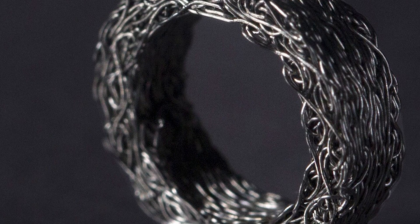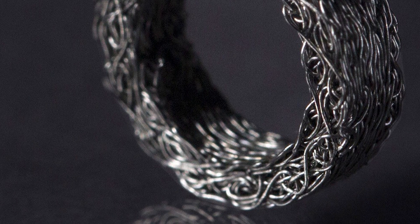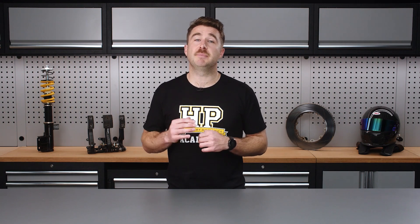In some cases, metal matrix type bump stops are used. Here the bump stop is made of a matrix of very small diameter wire. One of the main properties of this style of bump stop is that their rate can increase very aggressively compared to polymer, which is helpful when we're looking to limit travel very precisely — something that's very useful for aerodynamic reasons. Another big advantage of this style of bump stop is that they tend not to break down like a polymer does, giving more consistent performance over time.